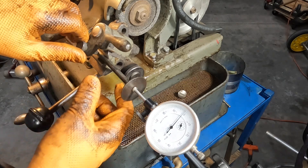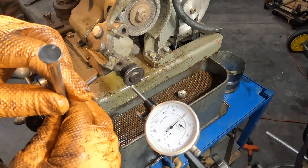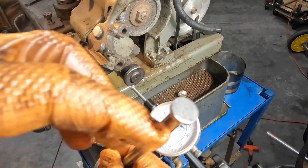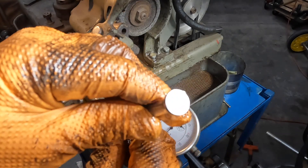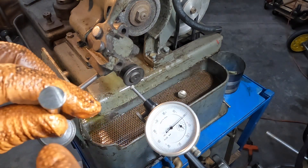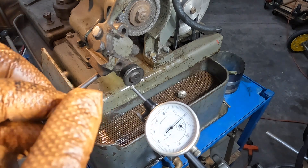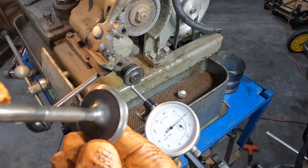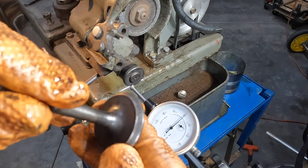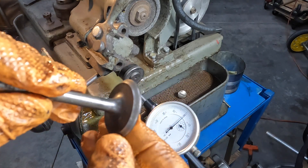Okay, so now I'm going to take it out and look at it. You can see we've got a really nice grind here, just the right way to reflect. We're not a hundred percent though — we're not all the way around. I think we're going to have to take a little more off because he ground quite a bit off the valve here. As you can see, we've got a nice even lap in there on the valve, so that's looking good.